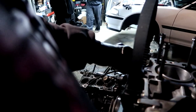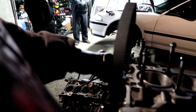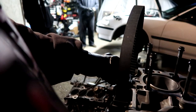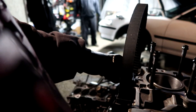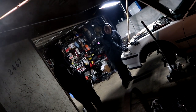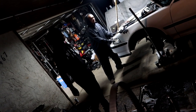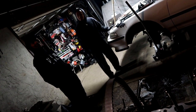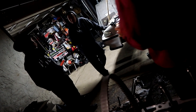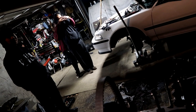You want to take a bet on how much horsepower it's going to make on your car? Spooling mini RAM, GTX3582R, built sleeved block, 10-to-1 compression, stock head, GSR cams, 20 PSI - what will it do? You're looking for 400 on 20 PSI? You can do that. My compression is 9-to-1, you have 10-to-1 - I did it on 15 PSI. 20 pounds on your motor with that turbo, if you have supporting injectors, you're probably going to be close to 500-plus.